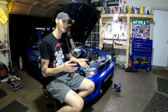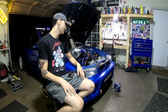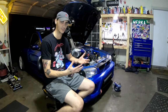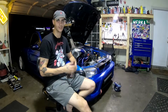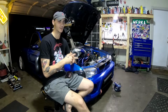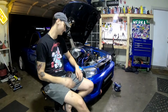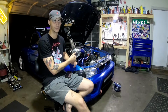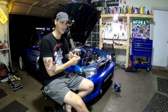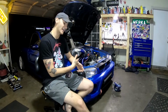But in the end, I'm still happy because I have a super accurate reading. I can see all the stuff, and I have two-step and all the nice stuff that comes with having a standalone ECU. But the next thing is a tune. If you have a standalone ECU, you definitely need a tune. So he was able to put me on the all-wheel drive dyno, give me a full tune, do my whole fuel maps. With the injectors, you're not going to be able to run bigger injectors on the stock ECU because it's going to push 50% duty cycle as if it's a 280cc injector, not as if it's a 1000cc injector.